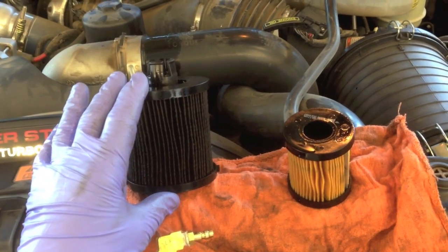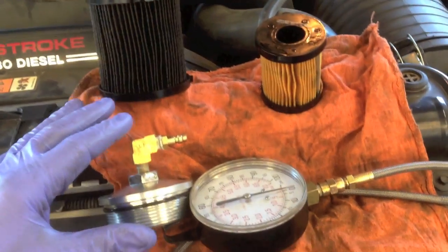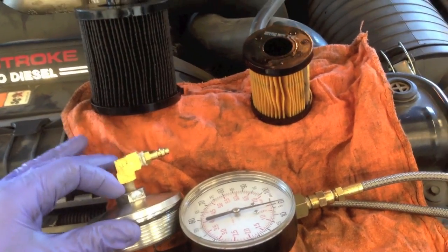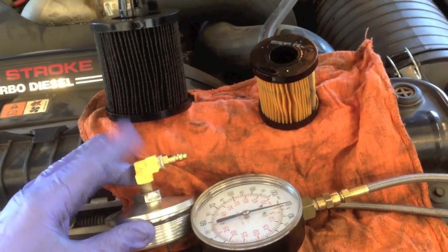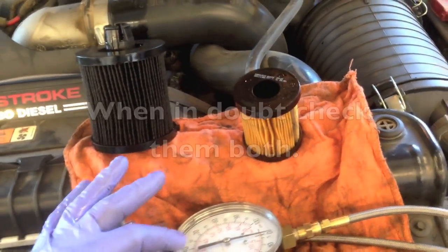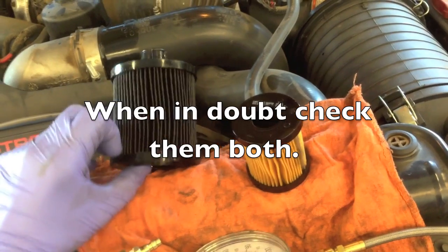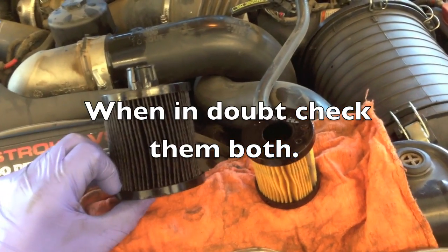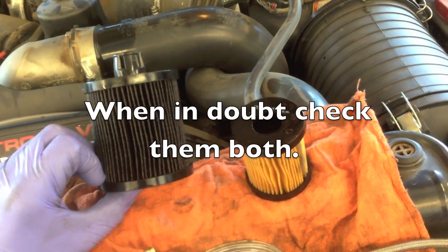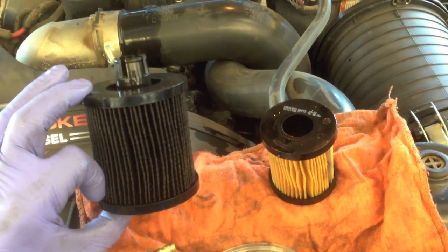So it's really important to make sure that you have the proper fuel pressure. To diagnose it, remember you're going to need a cap or the adapter to do it properly, a gauge that you can monitor while driving, and you want to check it under load. Also make sure that when the fuel filters are done, people are doing both the upper and the lower — otherwise you end up with multiple failed injectors. Hopefully this helps out. Please like and subscribe. Thank you.